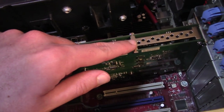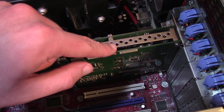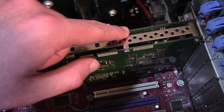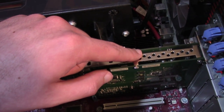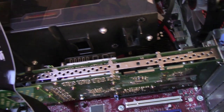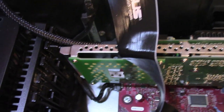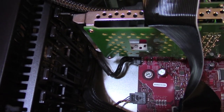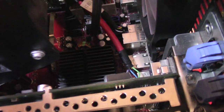One thing about some of these older cards is there are drawbacks beyond the usual CrossFire/SLI drawbacks. In this case you had to switch between four-way SLI and multi-monitor mode, so if you wanted to use more than one monitor you switched off a lot of your computing power. Once you were going to go into a game you'd switch to a single monitor, and you had to do that in the NVIDIA control panel. That's interesting — it's very much a workstation-type feature, much like the Power Mac G5.